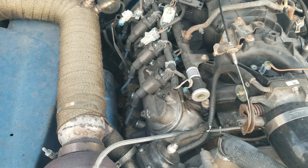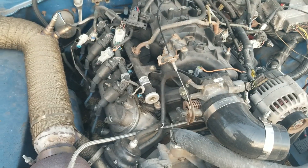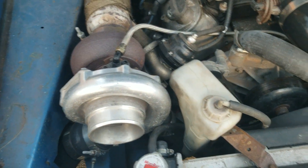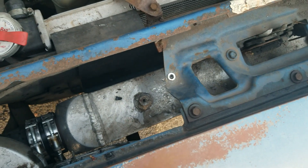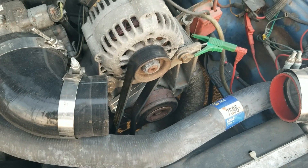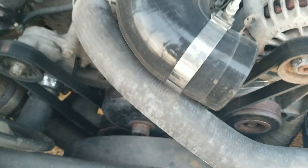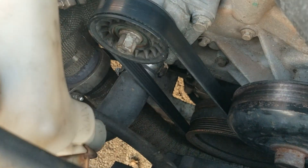I've had a couple questions about my piece of junk car here. It's a 5.3 Sloppy Stage 2 billet 7875 for VS Racing. Cheap used air-to-air intercooler crammed up in the front. Going around back, putting a blow-off valve in this pipe — that's why it's not in here. Got the ICT Billet relocation so the belt doesn't rub on anything except the hose now.